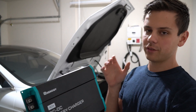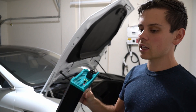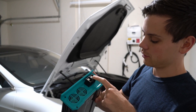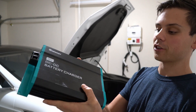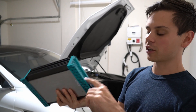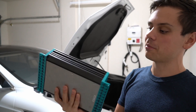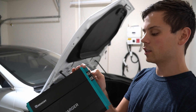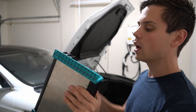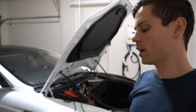This charger is a pain because it's not voltage-sensitive like the Victron or the Sterling, so you have to wire up your own ignition circuit to D-positive. But you could easily make a charger system: a wire from D-positive to the positive of the input, and then the output goes to your battery bank. These are cheap and have all the features you need — they charge lithium iron phosphate and everything — but a lot of people hate wiring up the ignition circuit if they've never done it before. Also, if you reverse polarity these will be done, so you have to know what you're doing and gauge the wires properly. But it's a great option for connecting your Tesla to your home solar power system battery bank.